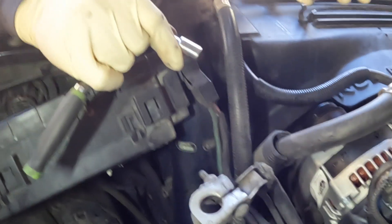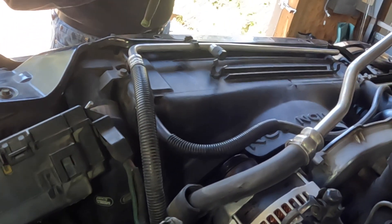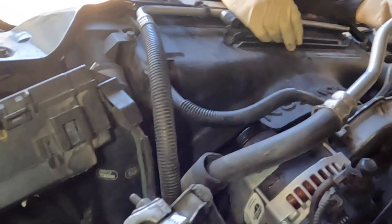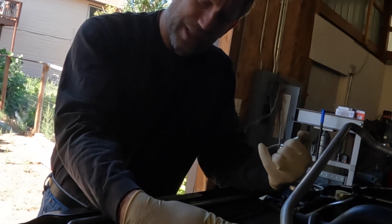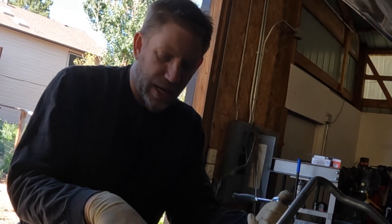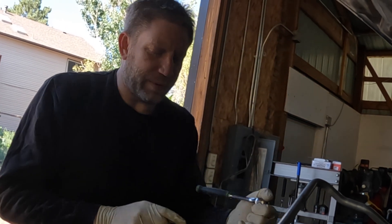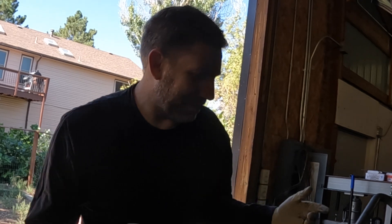The shroud is held with two little 10mm bolts on either side. This one has been modified from the last time we had to tear this down. We cut the shroud in half, so there are some additional nuts on this side that allow the top half of the shroud to be removed. That provides a lot more access to the fan, because otherwise you have to take the fan and the shroud off at the same time, and there's just not a lot of space to get to the nut that holds the fan in place. Highly recommended.